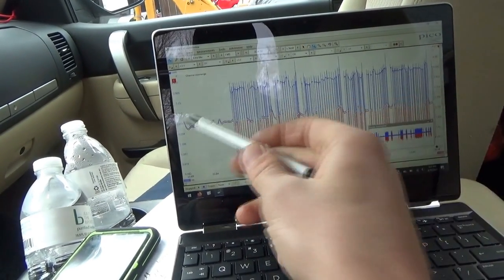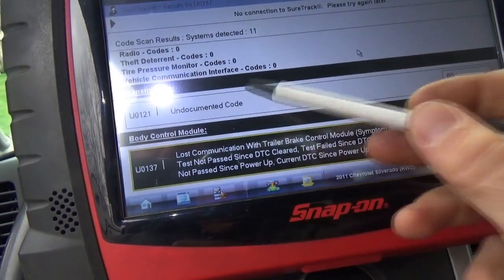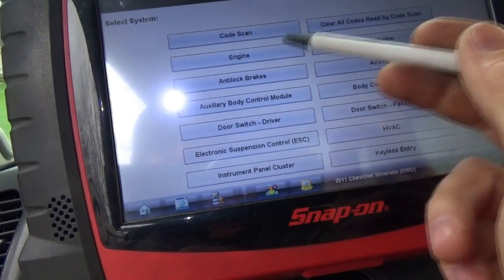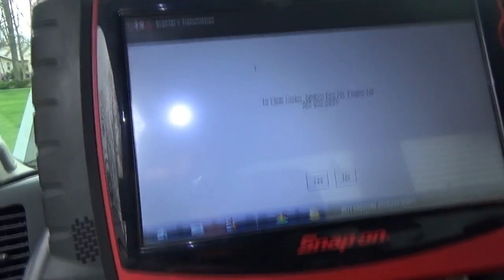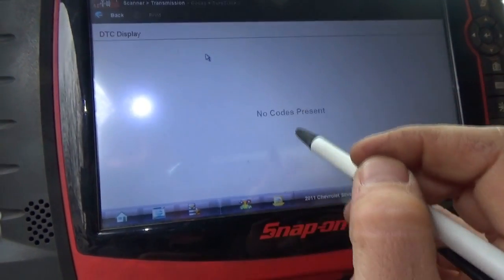Without the terminating resistor it'll have an issue, and it kind of makes sense that the ABS module went bad because it blew those huge fuses — something in there shorted. We could jump the pins across the ABS module to eliminate it from the system and make sure the trailer brakes work fine, but I think a new ABS module is needed at this point. The only codes left are one in the transmission — U0121 — and one in the BCM for loss of communication with the trailer brake control module since that's offline. The transmission code cleared after a key cycle — engine off, key on — and now shows no codes.